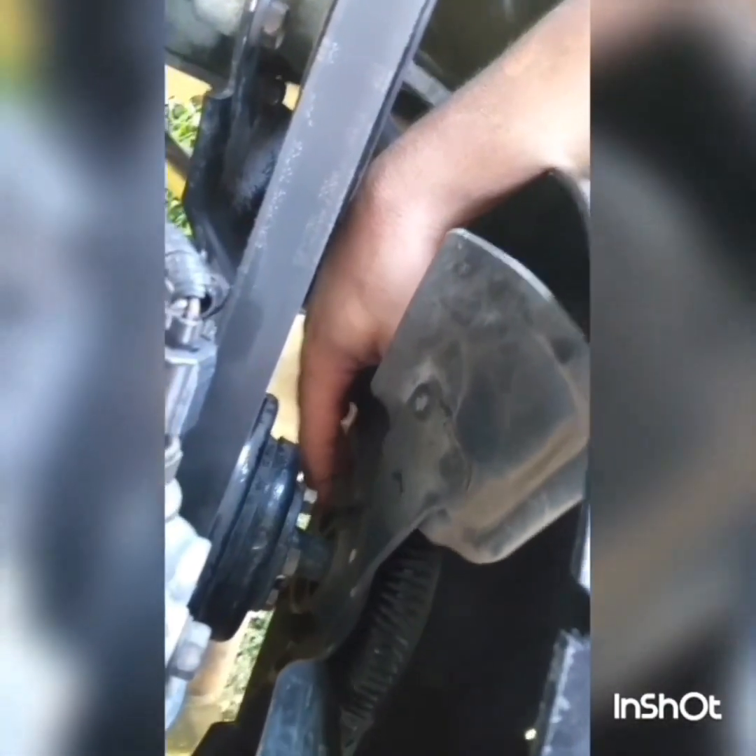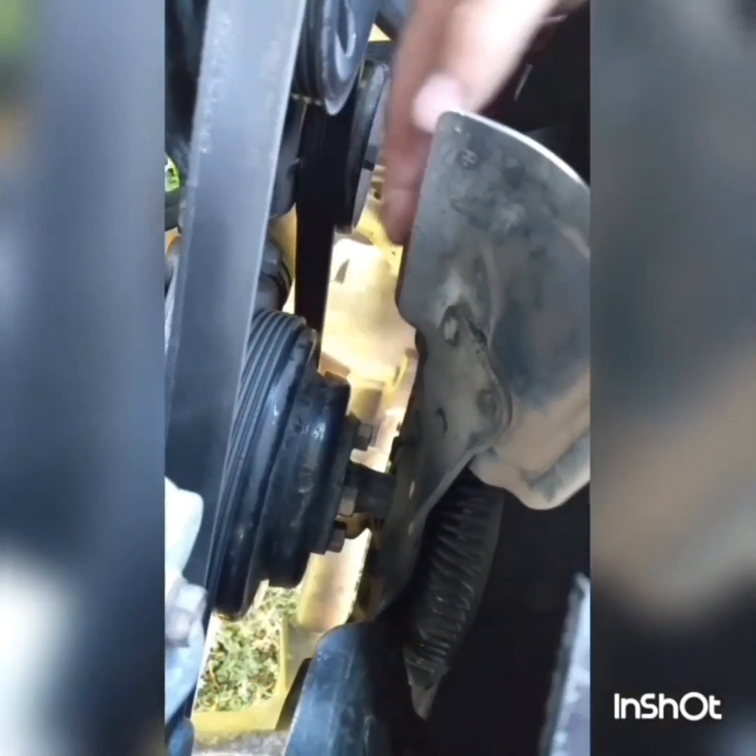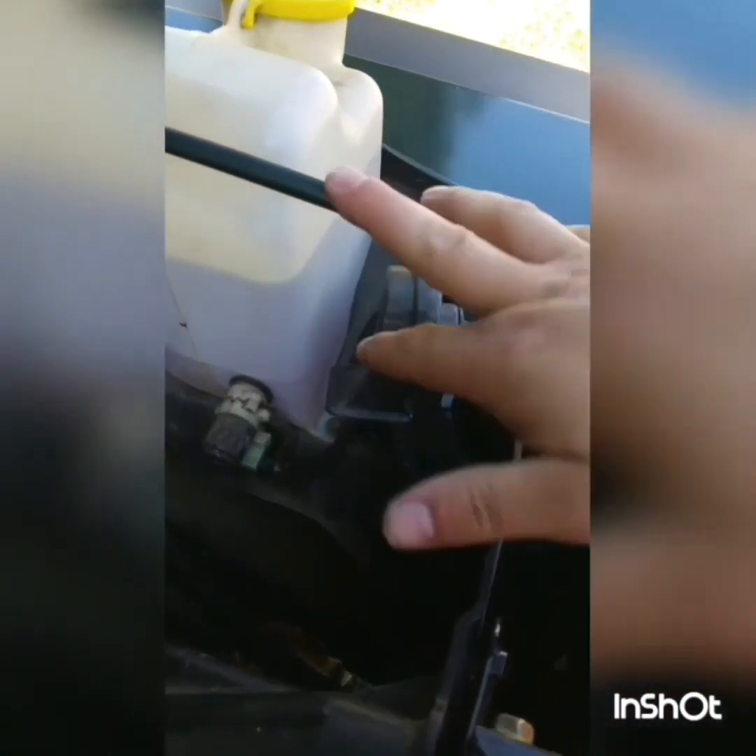Before you do that, you're going to have to get a half-inch wrench and a strap to hold the mechanical pump, and remove these four bolts with a half-inch or nine-sixteenths wrench — double check the size. Once the fan is unbolted, remove the four bolts for the fan shroud and pull it all out as one piece. You're also going to remove your overflow coolant bottle and set your power steering pump aside.